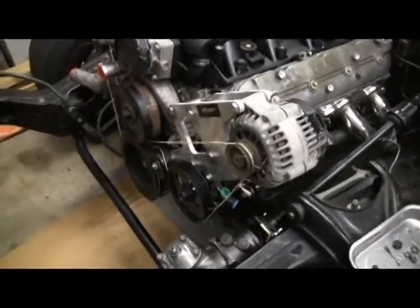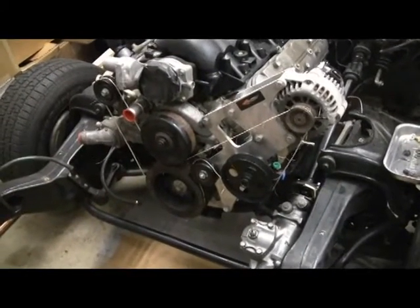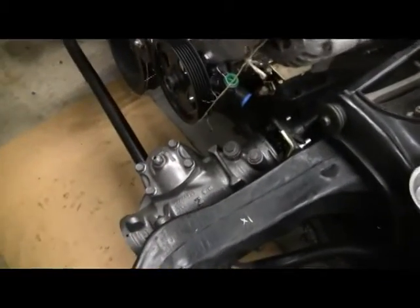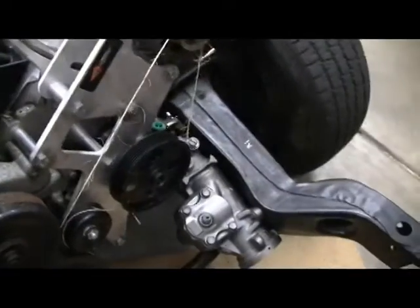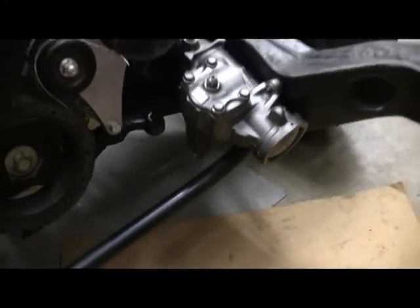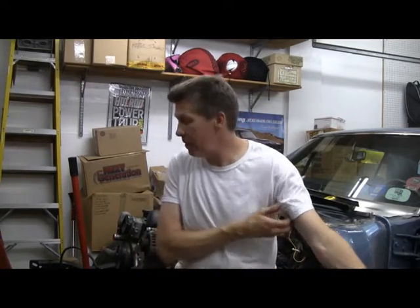So now what I'm going to do is throw the LS brackets, accessory drive and everything on and make sure everything clears. So I threw the accessory brackets back on and put my twine on for my belt path. No clearance problems at all. Plenty of clearance between the power steering pulley and the power steering box, which I was concerned with. Everything looks pretty good — the big box clears the sway bar. So we'll wrap up this one with success with the steering box and accessory drive and all the clearance that's needed there.